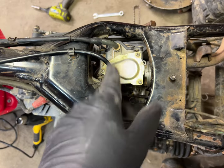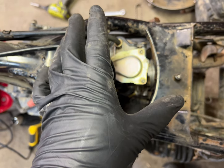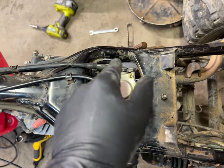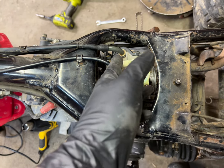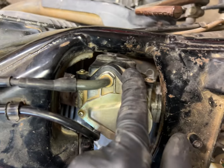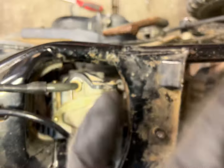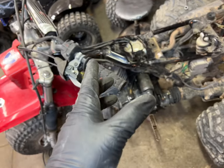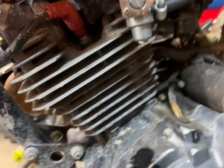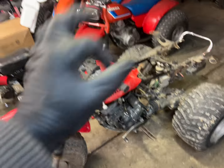Carb is back in. I told myself to put the throttle cable on first because you have to spin the carb, and then I put the choke on first - so I had to take the choke off, put the throttle on, then choke back on. Tip: take the clamp off halfway when the carb is halfway out - makes getting it in and out easier. Not going to put the airbox on yet - just put the gas on to make sure it runs first. Turned on the petcock and it started leaking fuel.